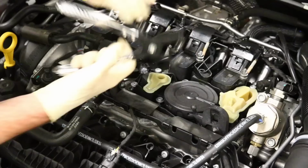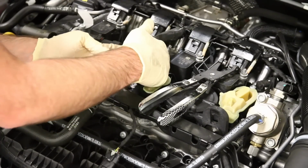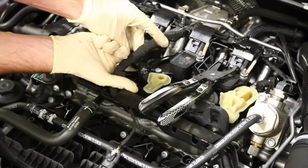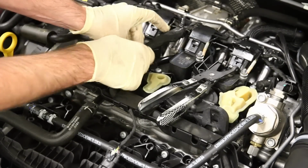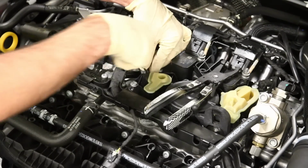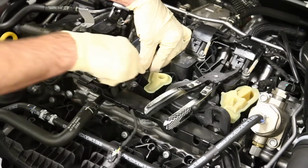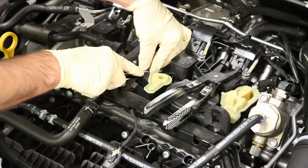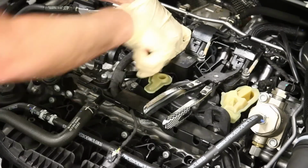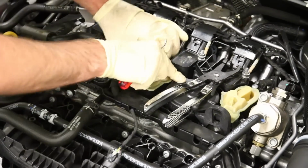But these hose pliers, you will want something like this. You can use regular pliers for these type of clamps, but they can be difficult without them. So we'll link to them in the description where we have those special pliers on our site for spring clamps. Now to remove these hoses, picks are usually not required, but they make your life easier because you can get in between the hose and then kind of just run it around. When a hose has never been off before, it'll often kind of bite onto the nipple, and so you can just run it around like that and it'll help you work it off.